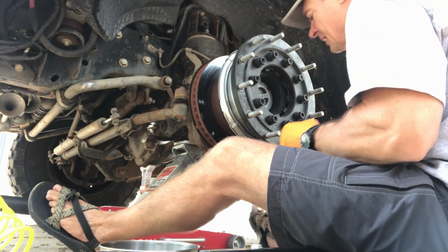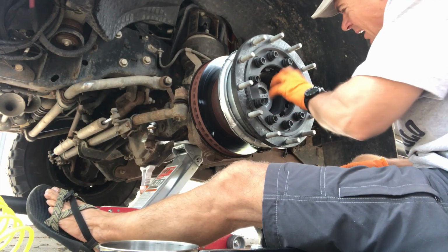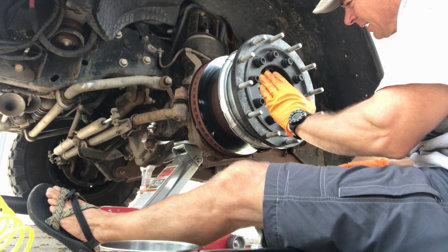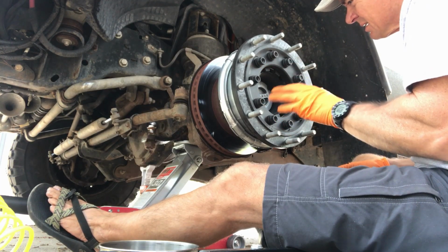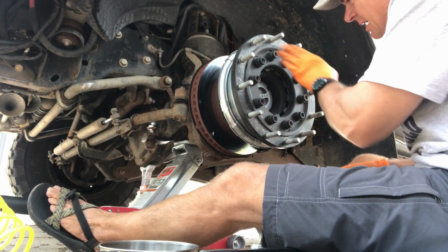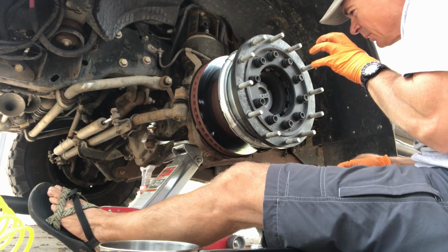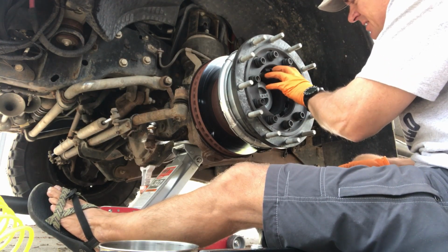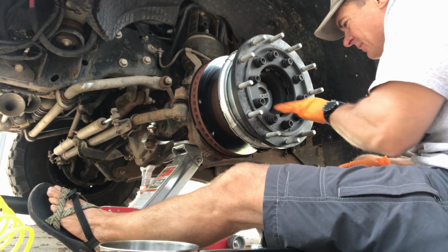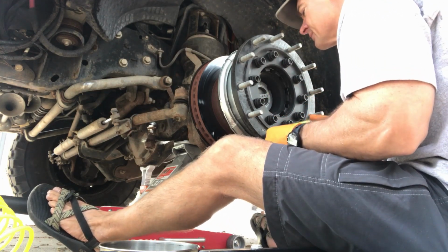And what I'm really looking at, there's a slight bevel on this hub assembly here. There's a flat, and then there's a very slight bevel on it. So I'm trying to get this to get off of that bevel all the way around until it's on the same radius, and then we'll just move it into the back side until it seats there. But getting it started on this flat surface all the way around evenly is probably the most critical part.